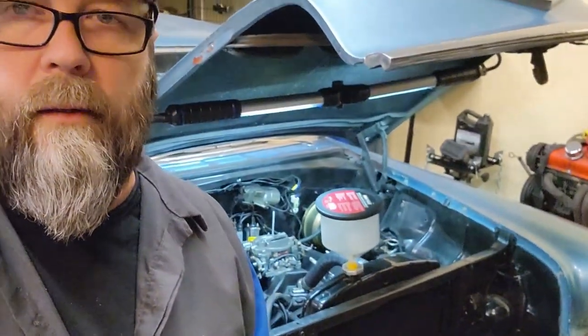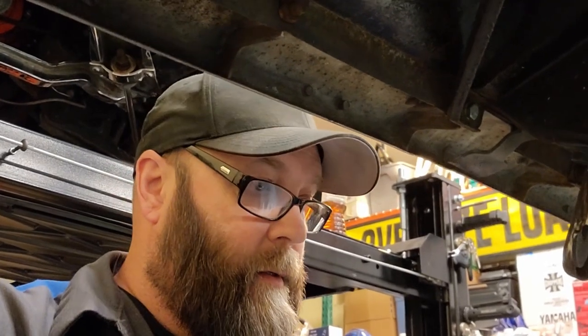Another day. Another headache. So, before I left last night, I decided to throw the old Nomad up in the air. And on the driver's side, back corner of them new valve covers I put in, a massive oil leak. So first things first, today I'm gonna go ahead and pull that valve cover out and see if somehow the gasket got pinched or something weird's going on there and why it's leaking. So that is what we're doing today to start with, and then that alternator, I'm gonna try something to see if I can get it excited because it's not charging.